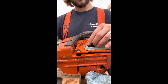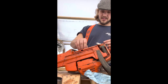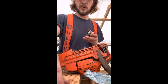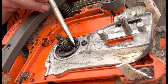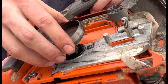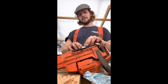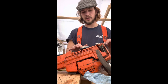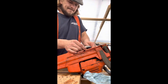It just goes on here — oh that feels so good when something goes on right and moves freely. It's beautiful. Make sure when you're doing this part: this groove right here is the line-up groove. Line that up — bam — just like that, this clutch cover piece goes on. Counterclockwise it comes off, clockwise it goes on. Get it to a nice tight point.